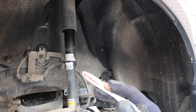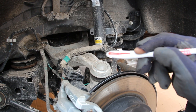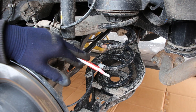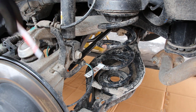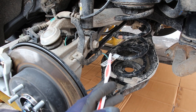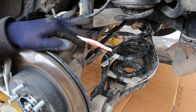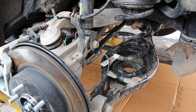Out at the back we have a multi-link suspension and it does remind me a lot of the G35s from back in the day. We have the strut that goes into the tower here and connects to the knuckle. We also have an upper control arm and at the front here we have the trailing arm. Over on the backside here we have this spring that goes into this large rear lower control arm. Now we do have quite the mix of materials back here — a stamped steel lower control arm, an aluminum upper control arm and knuckle, and a stamped steel subframe. Overall it's pretty good to have a multi-link suspension back here which is class competitive and should lead to better handling. However when it does come time to replace components, it's going to be a little more expensive because there are more components to wear out and it's a little more difficult to work on. You also have to make sure that these subframes don't rot out because they are made of steel — it's a typical Nissan problem for them to rust away after just a few years.